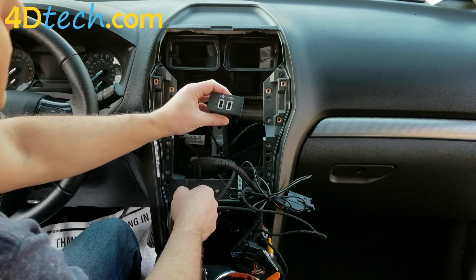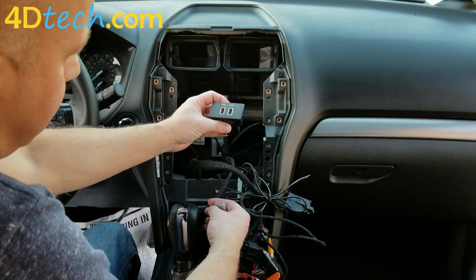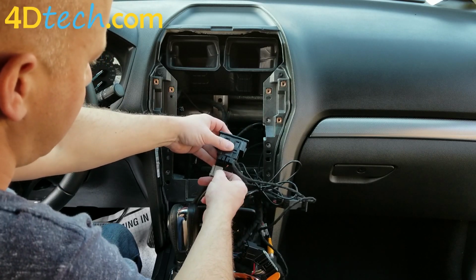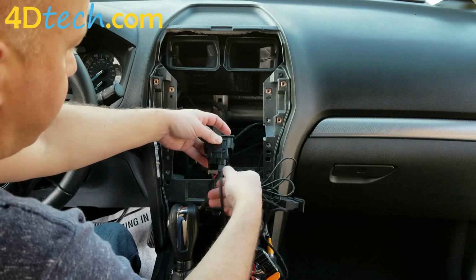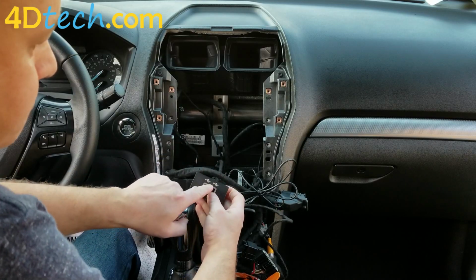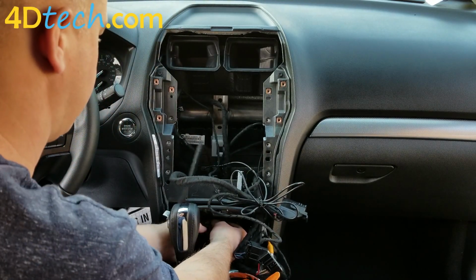We'll grab the supplied Android Auto Apple CarPlay compliant hub from the kit. Plug these connectors in. The clip will face on the outward side, and then the USB cable plugs in the connector diagonal from it. And then we'll take this with the USB symbols pointing up and slide it back in the hole where that plate was before.